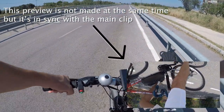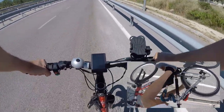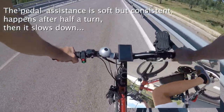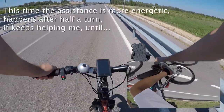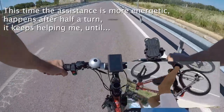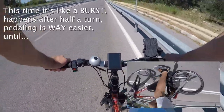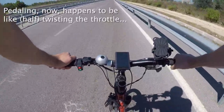Even with this kit you can ride like a normal bike by setting zero assistance or with the motor switched off. The difference in pedal assistance is evident — after half a turn you feel the bike pushing you as if there is someone behind you, until you reach the speed limit specific for that level. As you increase the assistance level, that force becomes stronger and your effort gets reduced, until you end up ghost pedaling — by which I mean pedaling not to provide force, but only as an input to order the motor to push at your place, unless you face a steep climb where you and the motor work together.